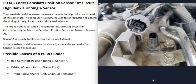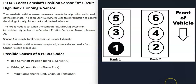When you get this P0343 code, the computer is seeing a problem with one of these sensors and it needs to be troubleshot. If you have a V6 or V8 engine, the engine is going to have two banks. Bank one is always the side of the engine with the number one cylinder. If you Google your engine's cylinder location or firing order, you can find the number one cylinder — that side of the engine is bank one, and that's the side the computer is seeing a problem with.